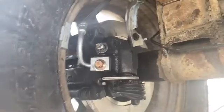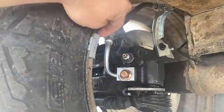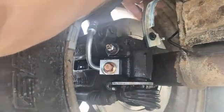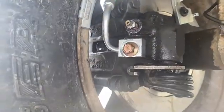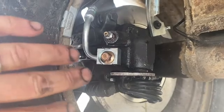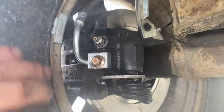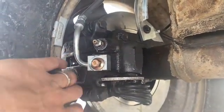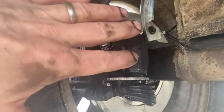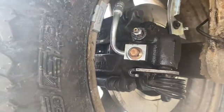That's really about it. All right, so I've got the wheels back on it and the tires, and it's back on the ground. So you can see I've got clearance here. I might want to bend that just a little bit to get a little more than that width there. I've got plenty of room up here behind this bracket. There's no clearance issues with the caliper. These are the 1994 to 04 Ford Mustang GT or V6 rear disc brakes. If you use the Cobra disc brakes, they are larger, and apparently they won't fit with the 15-inch wheel. So if you're going up a wheel size to 16 or 17, you could probably buy the Cobra setup, but if not, the V6 or the GT 94 to 04 rear disc brake kit will work just fine.